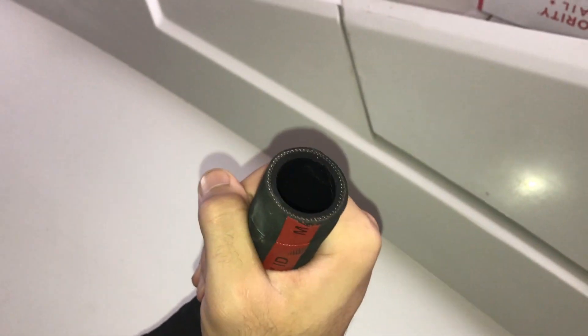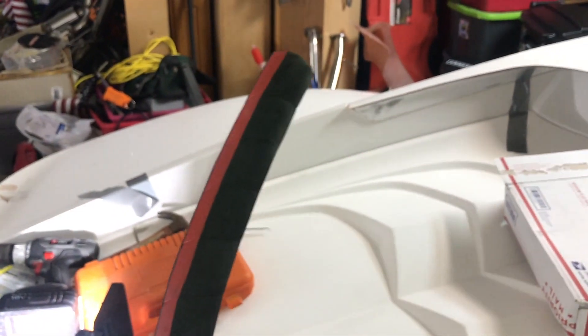I'm just going to cut the metal tube in there and fit this over both ends. I got five and a half feet of tubing — I measured before I ordered. You buy it by the inch and I measured about four and a half feet, so I got an extra foot just in case. This is going to run from the inside of the car from the metal line, all the way over to the middle, going around some corners. When the kit is off the car, we're going to reroute the gas line and also install the inner rear fender liners, because both have to be done before we install the kit permanently.